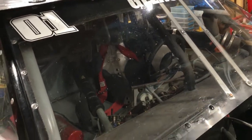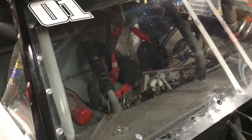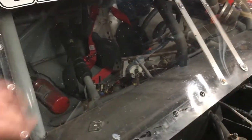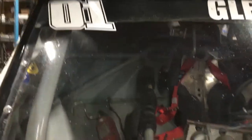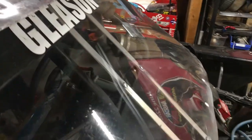So that's basically it — compound and then polish. What looks like a lot of rock chipping or little white dots, you can see if I move the camera — that's all deep staining or deep etching caused by chemicals or whatever. But if you look through it, it looks really clear. This windshield is from 2015, and aside from glare and stuff, it actually is pretty clear. You can look right through that thing. I'm going to go do the other side and then this thing should be done.